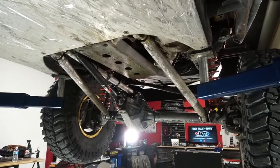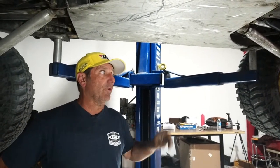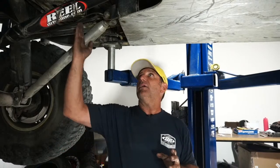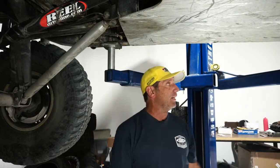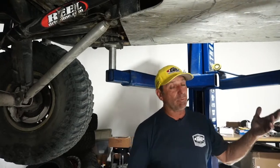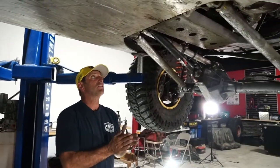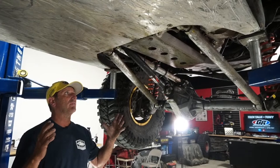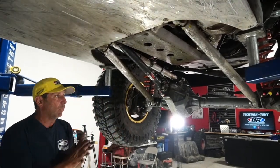Q&A: Weight of Teramoto and front vs. rear balance? There is more weight on the front. The rear is actually very light — I've tried to move as much weight rearward as I can. My transmission cooler is back here, batteries are back here, and the 36-gallon gas tank is all the way in the rear. I'm running an LS engine, which is aluminum and 150 pounds lighter than cast iron, but I am running a giant 4L80 transmission and Atlas transfer case — both heavy. It's all about putting strength where you need it and having the right spring rate and bump stops.